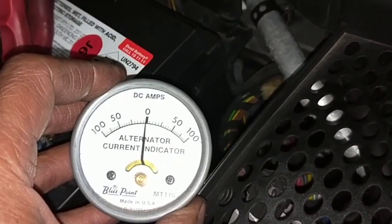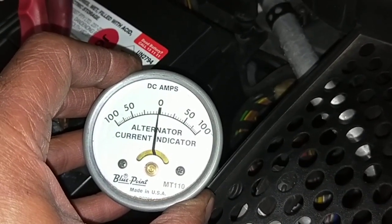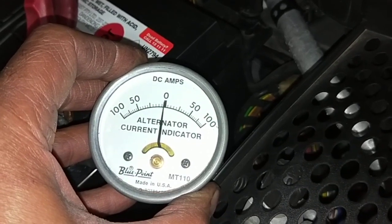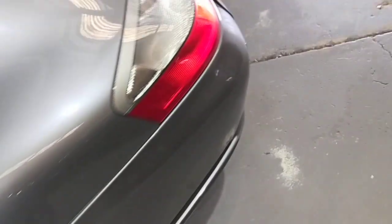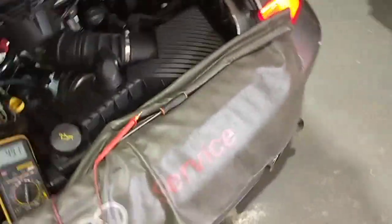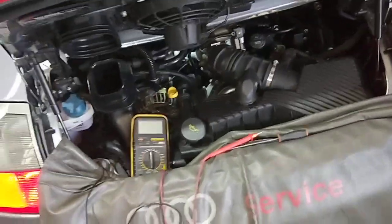Let's go back to the 996 — it's showing probably about 1 to 3 amps. So this car is running at 3 amps while the other car is running at 15 amps. It should be higher than that — 15 to 20 amps. So I can actually say the alternator is not charging, by looking at the actual amperage.